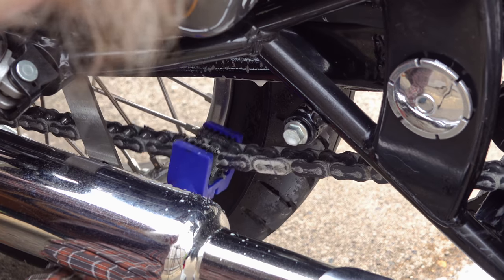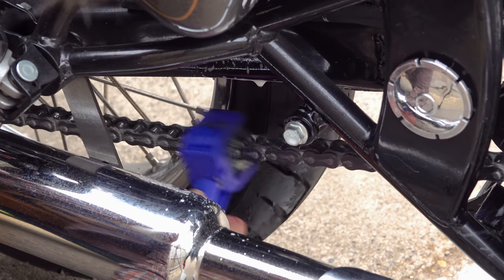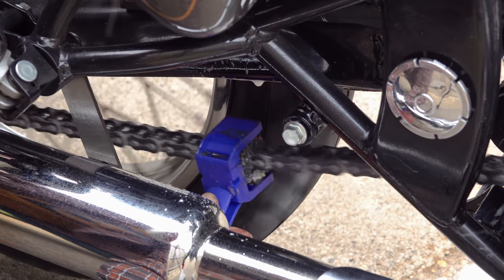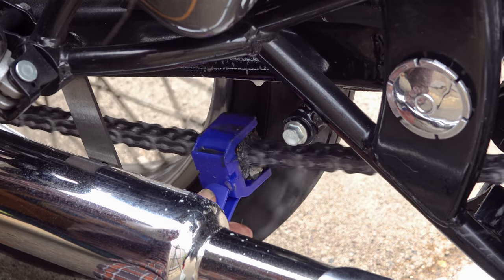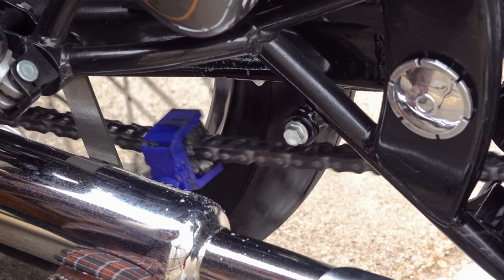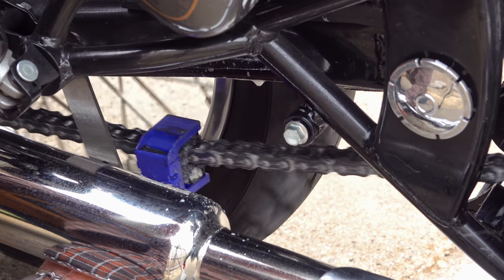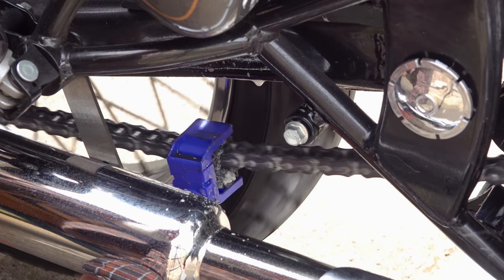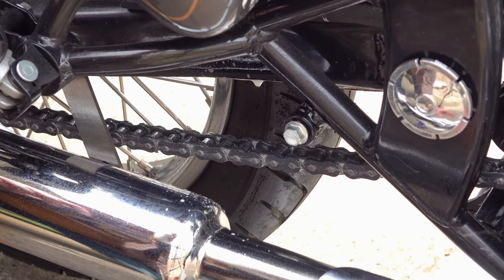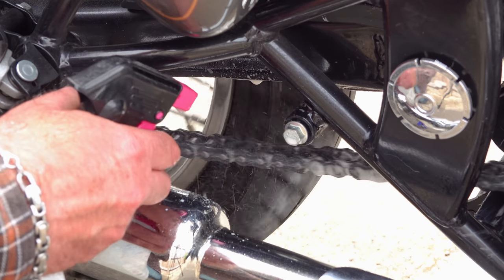I never adjust a dirty chain, or very rarely adjust a dirty chain. So, generally speaking, whenever a chain needs adjusting, I go through a complete cleaning procedure, not just of the chain, but of the swing arm, the chain guard, and anywhere else that chain lube fling collects. Generally speaking, this stuff does absolutely no harm. In fact, in some respects, especially where chrome rims are concerned, it does protect from rust,